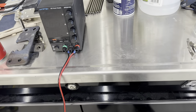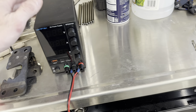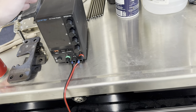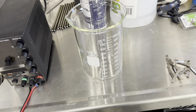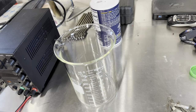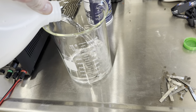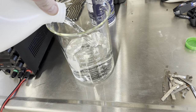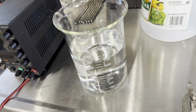Everything to do this I purchased for under a hundred dollars. You can do it without one of these but I highly recommend it — you can just do it with an old charger and a couple batteries, but this rectifier makes it a lot easier. It can be bought online for like fifty to sixty dollars, so it's not that big of a purchase. You'll need some sort of container — I prefer glass, this one's Pyrex just so it'll handle the heat. When you're plating, depending on your voltages, it can create a decent amount of heat, so I prefer this over plastic. And you'll need some vinegar — pure white distilled vinegar, ten percent is preferable, though I could only find five percent and it does work.